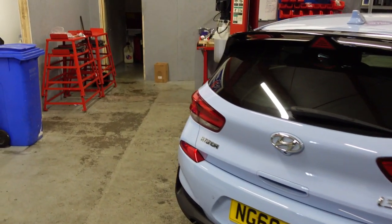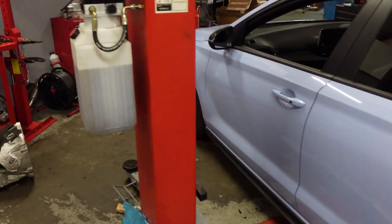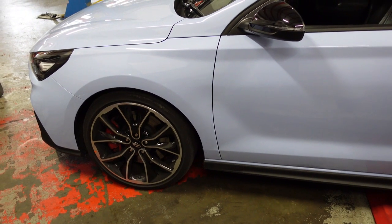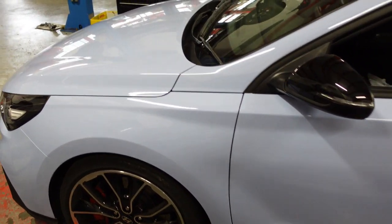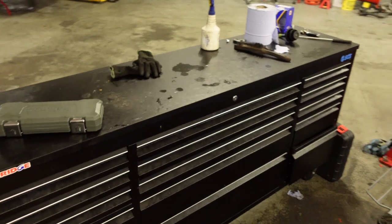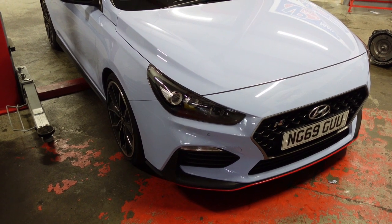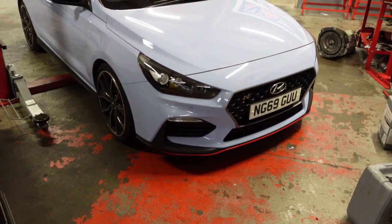So we've done the exhaust. There's a few mods we've done in here before. It's had a GPF delete. It's also had a forged induction kit, the 4-inch one, large one, bigger turbo inlet. It's got a tuning box on it. It's been on the dyno at GM Imports, local company to us, really well known. It made 325 brake, so it just doesn't hang around.